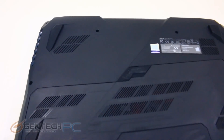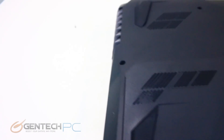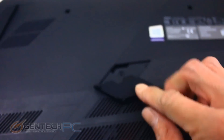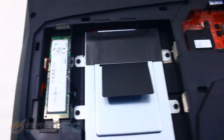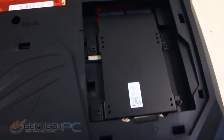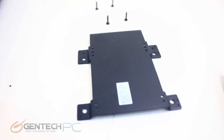Now it's time for the last segment of our review — the system disassembly. We have some really good news: the design makes it very easy to get access. Just one single screw lets the bay door open and come right off, giving you immediate access to all user-upgradeable components. We have an M.2 SSD already occupied on the left, right next to a 2.5 inch mechanical storage drive. On the right hand side there's a slot for two more M.2 SSDs, and in the center, two RAM slots. Only four screws are needed to remove the plate for the extra SSD slots — a very easy upgrade.